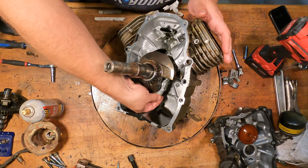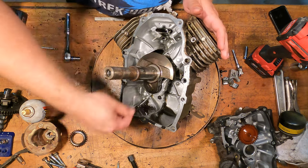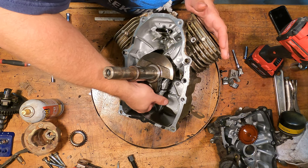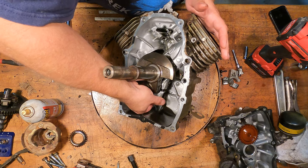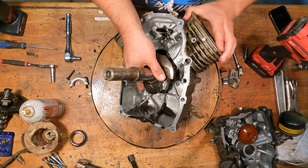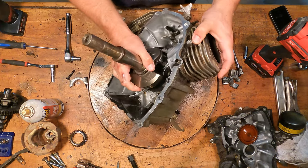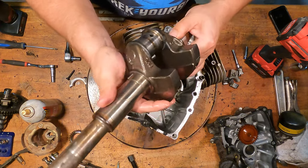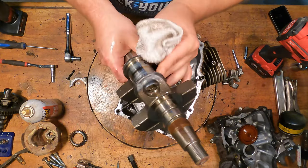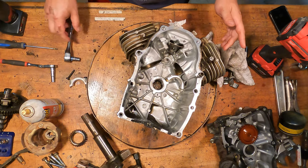It's kind of like doing half the work with only one connecting rod. These normally have some kind of a bend tab so this doesn't happen — I don't understand why this one doesn't. I'm just going to turn this crank and push this piston up. I'm going to pull the crank out. The important parts are smooth for the most part — smooth enough. The crank looks good.